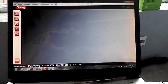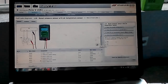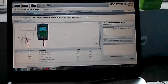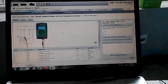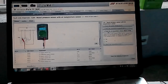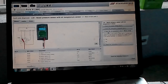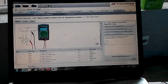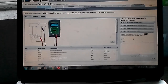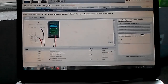The car is going to run as it should. To summarize the diagnostic procedure: check supply voltage on pin 3 - there should be 5 volts. We have ground on pin 1. On pin 2 there should also be 5 volts. Check the connectivity of pin 4 to the engine control unit at connector A883 - there should be 0 ohms, meaning it should be directly connected.